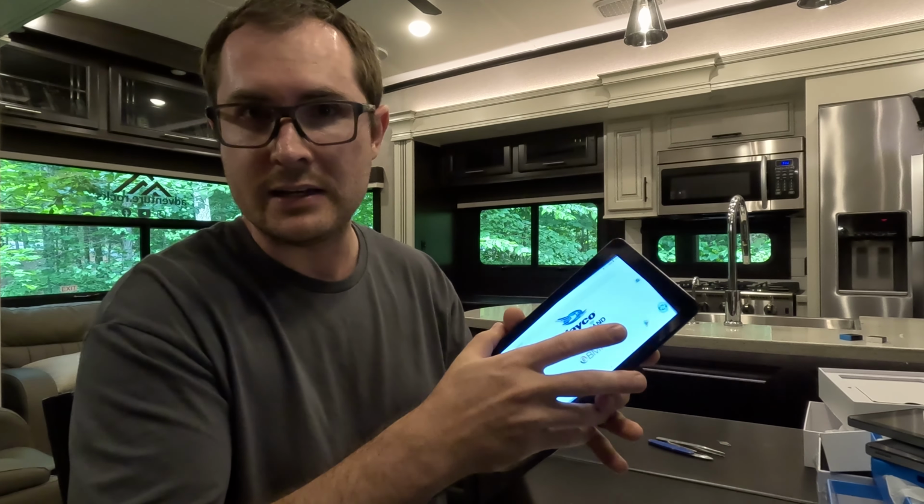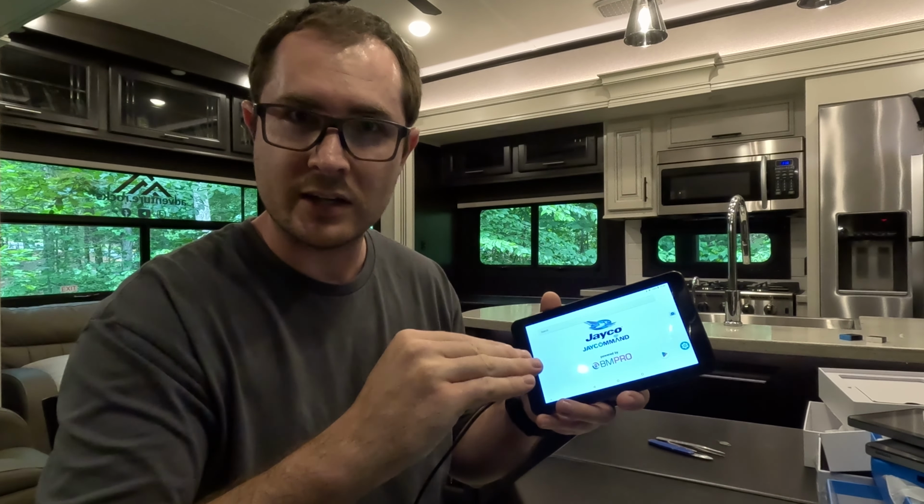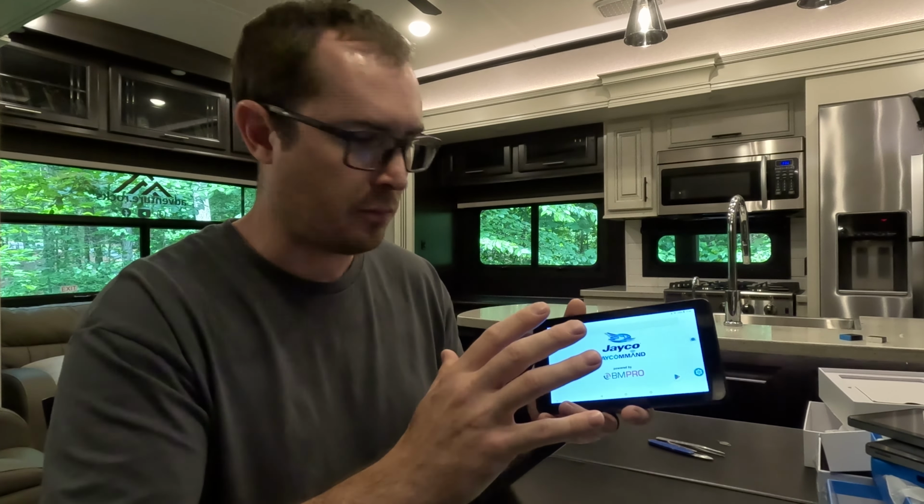And then I also noticed that the battery meter, even though it's plugged in when it's docked in the bezel, was kind of fluctuating. Normally it stays at 100%, but it was dropping to 70, 80%. Basically I think what's happening is when the operating system on the tablet detects a battery voltage issue or something that's a little bit out of range, it's trying to be smart and say, hey, the battery is weak or low, so let me slow down the processor and some of the other resources on the tablet to help conserve battery power. So basically Android was trying to be smart, I think, and that is in turn what I believe was causing the tablet to be sluggish and unresponsive.